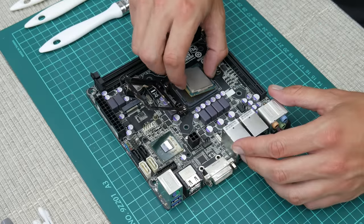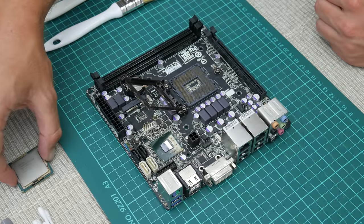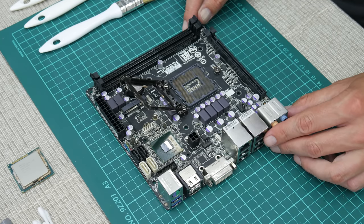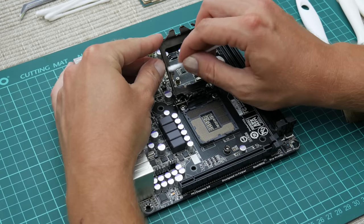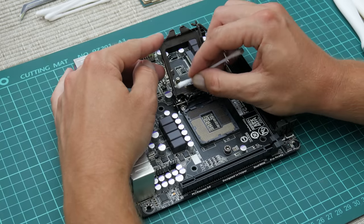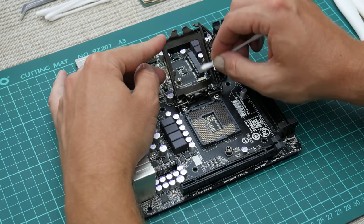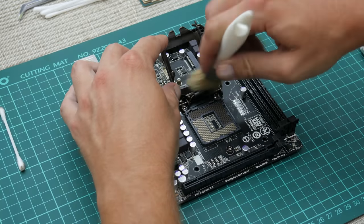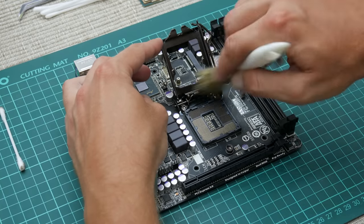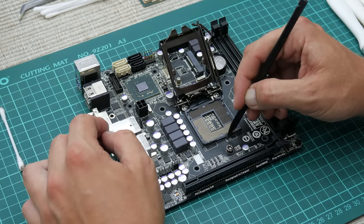After finishing with cleaning the motherboard from all sides, it's time to remove the CPU. There is thermal paste on the CPU bracket from the inside and on the plastic from the socket, which means too much thermal paste was used. Cleaning the socket requires a lot of patience and precise work — no rushing here. The socket pins are easy to bend and damage, but hard to repair.